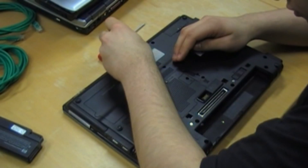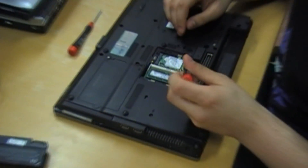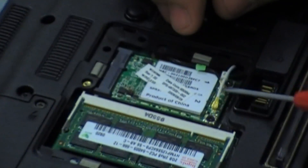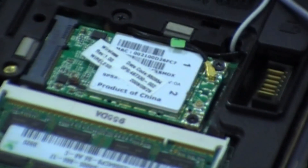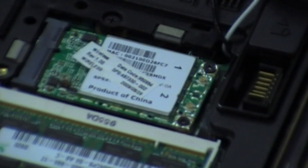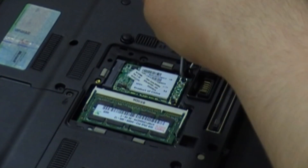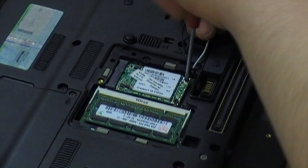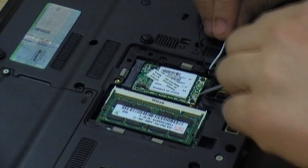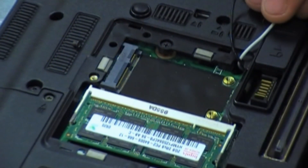Remove the cover on top of the Wi-Fi card and just pull it out with a regular screwdriver. To the right you can see the Wi-Fi card. You have to pull out the wires that are connected — there is a white one and a black one. It is really simple, it just takes a while to put them back together. You can see the two screw holes where the screws hold the Wi-Fi card to the cabin of the PC. Just unscrew them and lay them to the side for later use. Then lift the Wi-Fi card and pull it slightly out of the tracks.